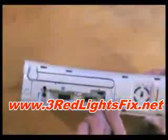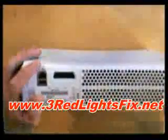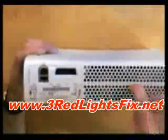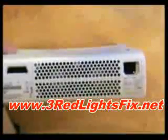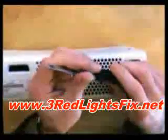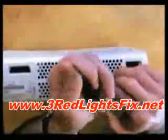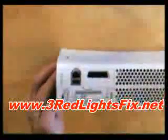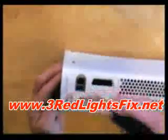You've now got your four clips here — these ones are very easy to do, but the ones at the back are the fun ones. To take the case off you're going to have to push in all the clips on the back: there's five here and two here. You can either use a small flat head screwdriver; I tend to use one of these — a little knife. It looks wickedly sharp but is very, very blunt, and because it's so thin it doesn't leave any marks at all and it's also quite easy to push in. What I'm doing is pushing this apart and at the same time pushing in on the clips — you'll hear the clips like that.